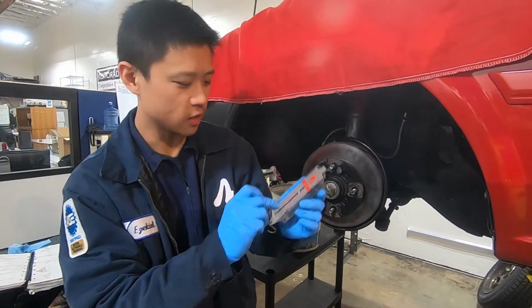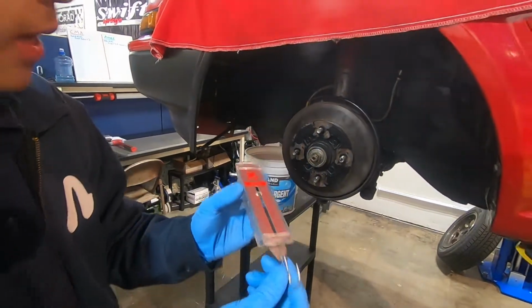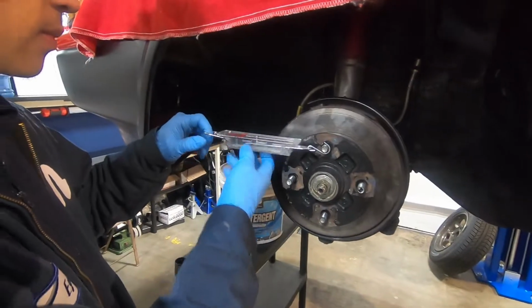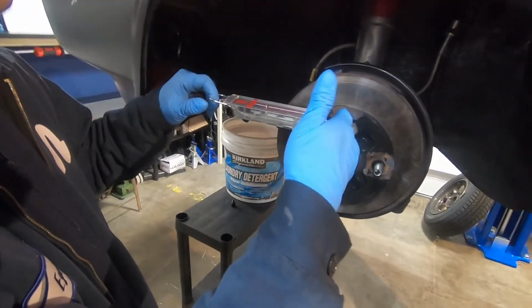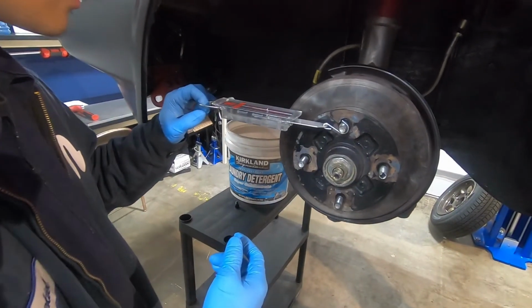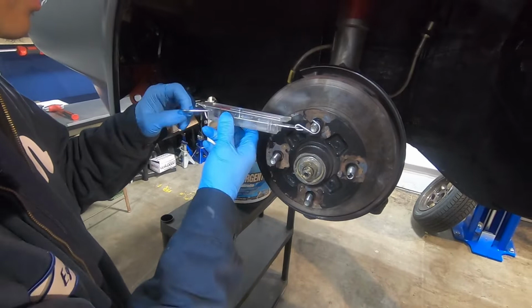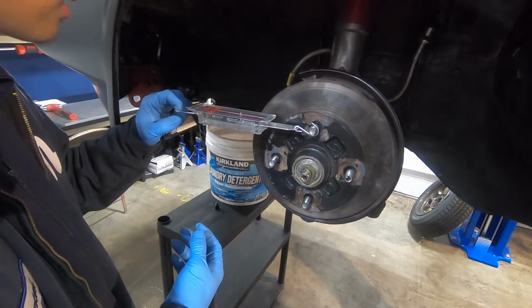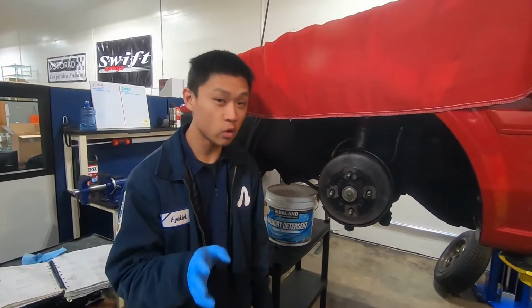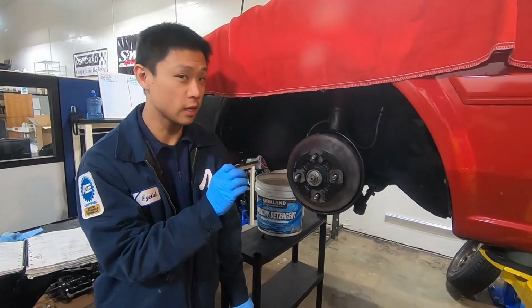It's easy enough to go to 10 Newton meters, so I'll just do that. We'll put our spring scale at 12 o'clock, and I will pull on this. You saw this thing move, and I'll do it again. That's about 11 Newton meters. I'm okay with that. These will only get looser with time, so I'm okay with 11 Newton meters.